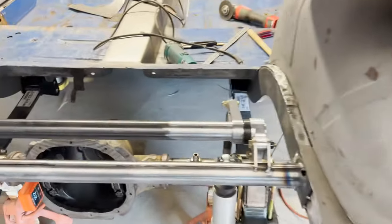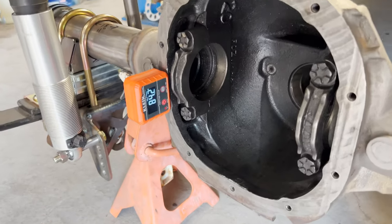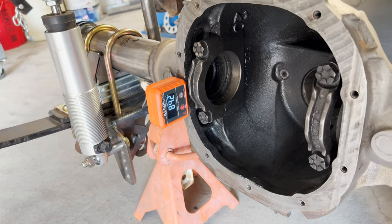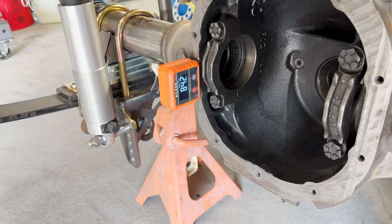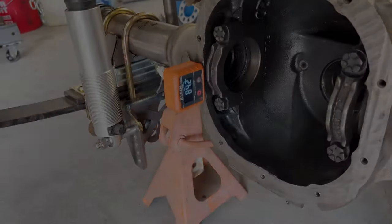All right, I moved the jacks and we moved, we're about 6 degrees down. So, wait, where are we at? 84, yeah, so we're about 6 degrees down. It really needs to go up about 3 degrees. So I'll probably raise the car back up. Probably just put it at zero and then let the car back down, and that should give us 3 degrees.